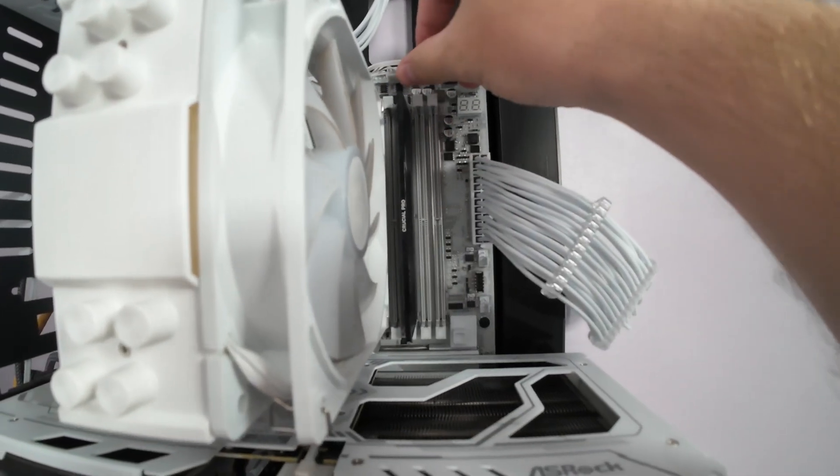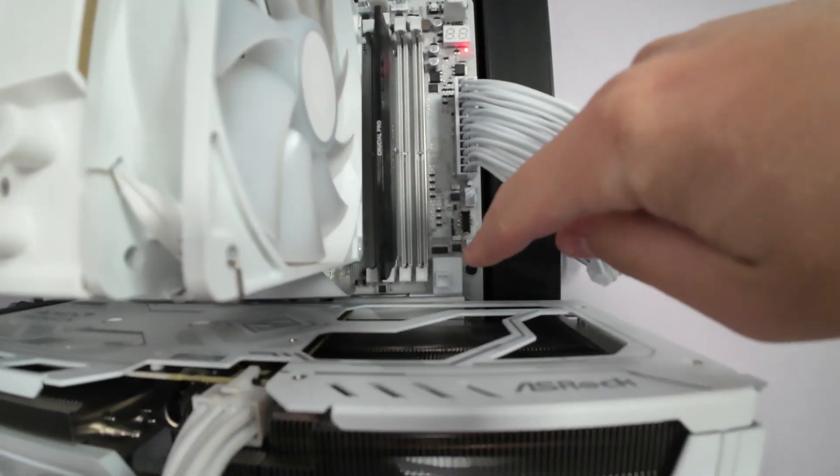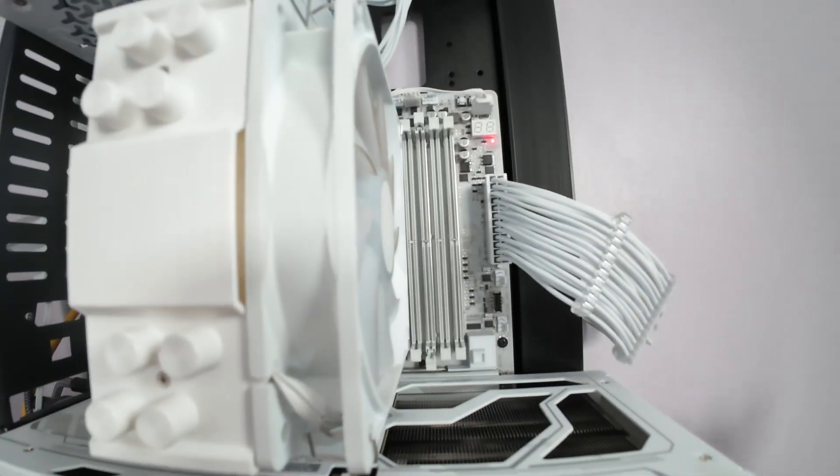You can see there are four slots on your motherboard. The prime main spots you want to use are going to be your two and four slots. If we want to uninstall RAM, we just push these little levers on the top here, and then there'll be one on the bottom like so, and then you can just pull your RAM on out. And that's how you uninstall RAM.